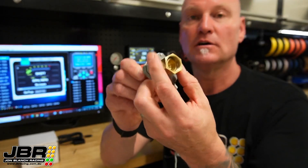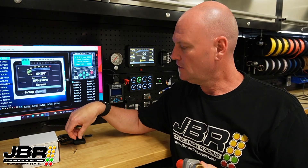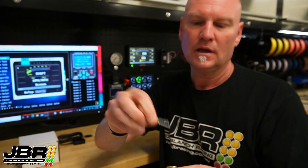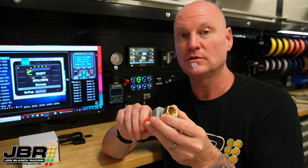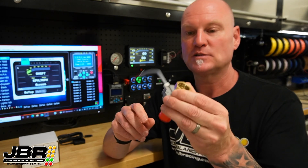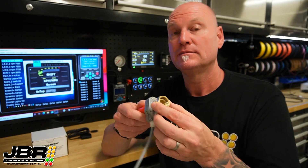So that's where one of these units comes in. The drive unit itself just screws straight onto the side of the gearbox, and then you've got this small drive piece that slots into the drive unit and goes into the gearbox where the original speedo cable used to go — that's what drives the unit. Then when the car starts moving, it just sends a pulse signal straight to the dash.